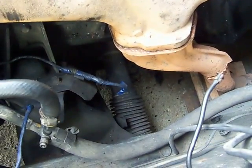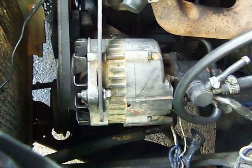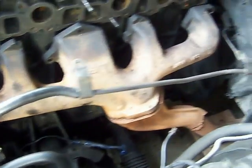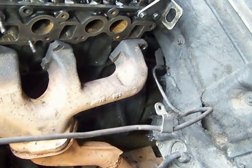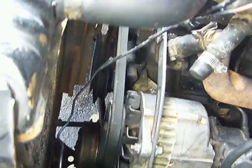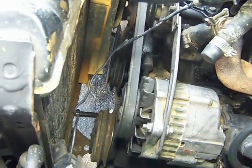Now there's the steering rack. This is the alternator. A note about these alternators — they generate a vacuum here, which is connected to the transmission. Down there is the air conditioning compressor, and a big pulley at the bottom.